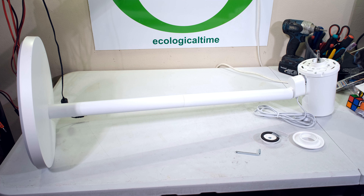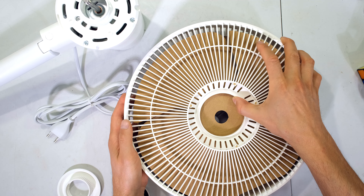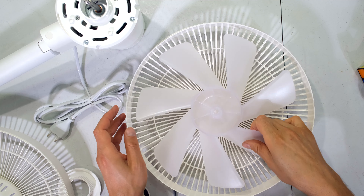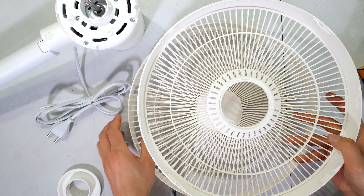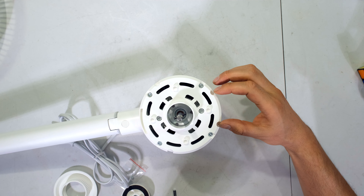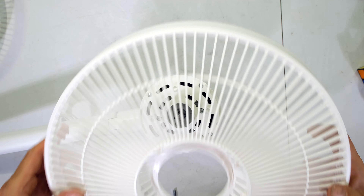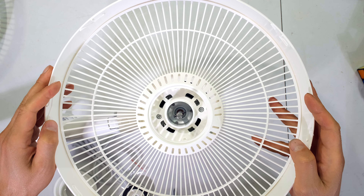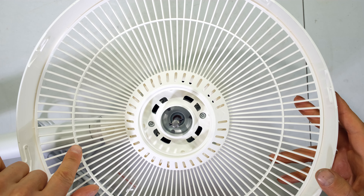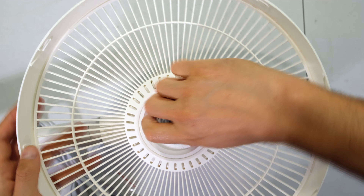Now I'm fitting the grille onto the fan unit. I twist open the packaging, remove the bottom from the top, take out the packaging material, and set the fan aside. The bottom grille fits over the fan unit — there are two narrow recesses and two wider recesses that correspond to matching lips, so it can only fit one way. There's also an arrow indicating upward orientation, away from the base. Push it in firmly, then screw the retaining nut in clockwise.